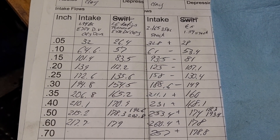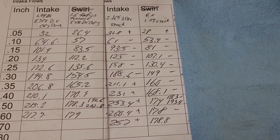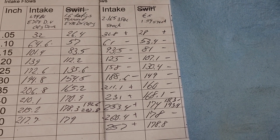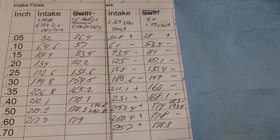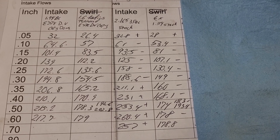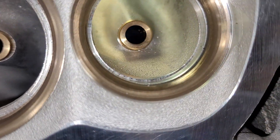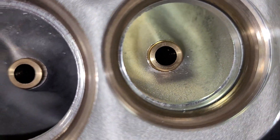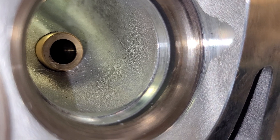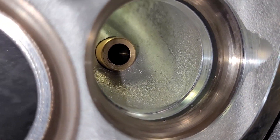Take a look at the exhaust. It's a 1.6 exhaust on the E7TEs with a tiny exhaust port, and the LS3s have a 1.59 valve stock — it just didn't have a back cut or anything on it, which is probably the way I would use it. It gets beat at every single lift point. The exhaust doesn't look bad, but you can see it does have a pretty heavy ridge going in from the radius. They got a decent valve job on here — not spectacular.